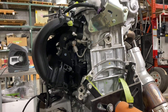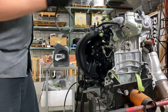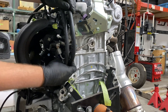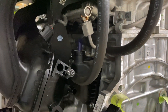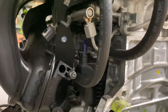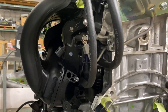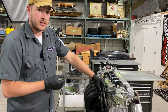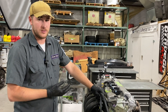You are then going to take your provided hose and loop it, then feed both ends down and back behind the engine. You're going to feed one end onto the PCV valve and one end onto the intake manifold. Now, if you have a naturally aspirated car and you're planning on staying naturally aspirated, you don't need to worry about hose clamps — it's been proven they hold up well because the engine's only under vacuum. If you do have a boosted application or if you are intending to boost your car at some point, you do want to add hose clamps. This particular car is a 2019; currently no forced induction option for it.